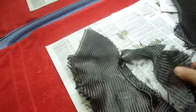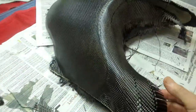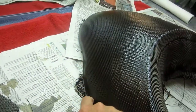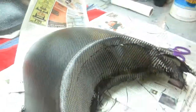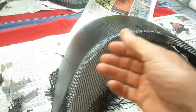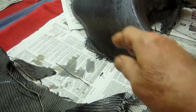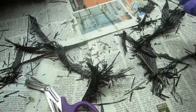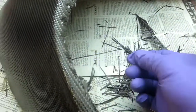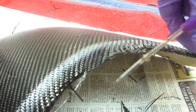Today this has been dry in 24 hours. Some edges are still soft and we can use them. The parts that have drips of resin on them we can't use, but I'm going to trim off using an ordinary pair of scissors — just trim that back, and then the final little bit I'll do either with the Dremel tool or with a sheetrock knife. If you're using a Dremel tool and one of these carbon threads gets caught, it wraps around it and sometimes you break the shaft. So get all the soft stuff off first, leave all the hard stuff, and then you can grind it or cut it — there are a number of ways of doing it.